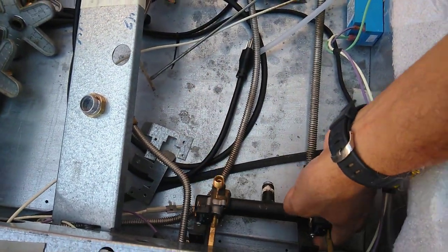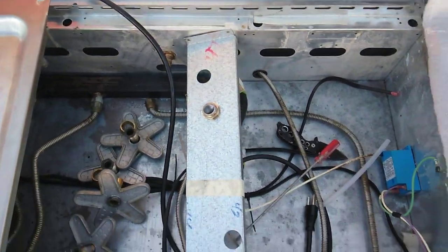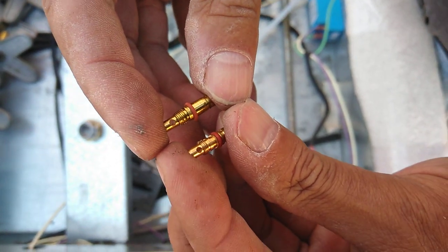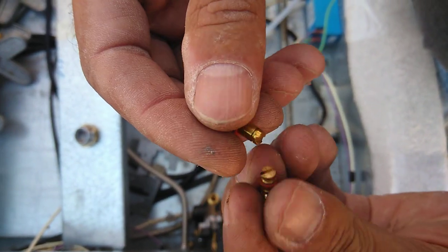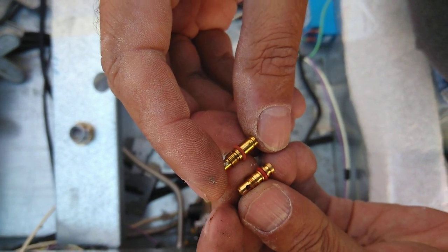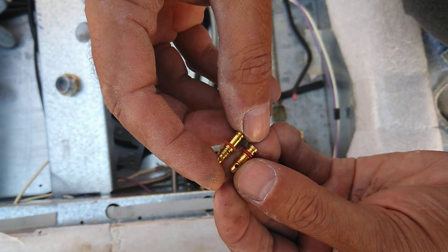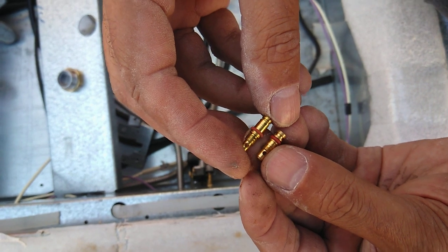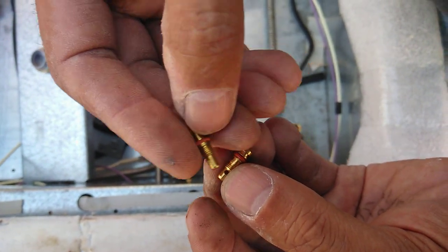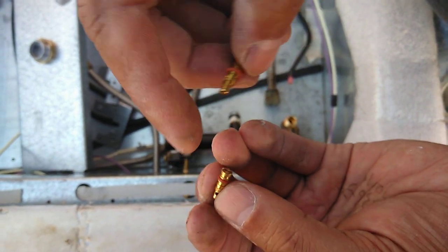There are two different size jets. If you need to contact me, let me know which one it is — I've only seen two size jets in the industry, so it should be one of these two types. If there's a third type, I'd definitely want to know about it. I do make these — they're a pain to make, but I do precision work on them. I start with blanks and drill the hole based on the number of the original jet.